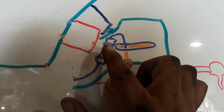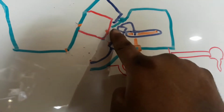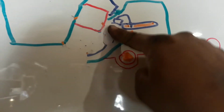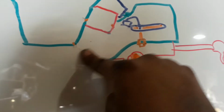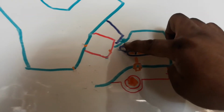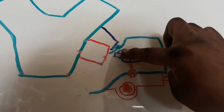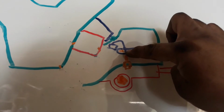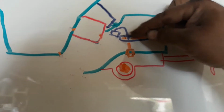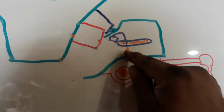I was in the car for at least 2 hours trying to get this section off, and I finally got it off. So now we no longer have that part of the line. The whole high pressure line is out. And once I got it out, I noticed that there's this fitting here where the high pressure line plugged into, and the metal line that goes down in here, and it goes through this hole that's on the frame.